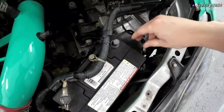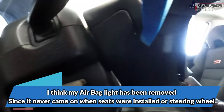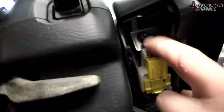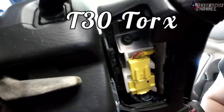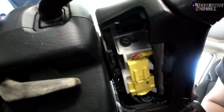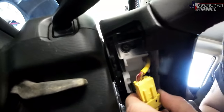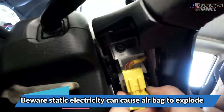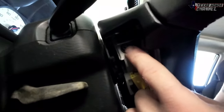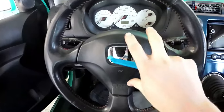Moving on to the inside — we have the back side of the steering wheel right here. I'm going to remove that panel and we'll have access to these star bits. If you don't have a security bit set, I definitely recommend grabbing one — AutoZone, O'Reilly's, Advanced Auto Parts, NAPA, all these places usually carry it. We've got the airbag clip here, which is a spring-loaded little clip. You can see it goes down and just disconnects — really really simple. I'm going to remove these screws on both sides and get the airbag taken out.